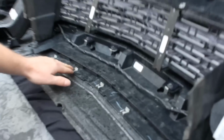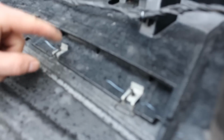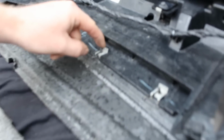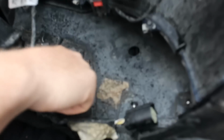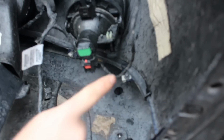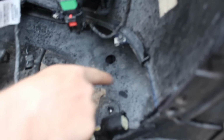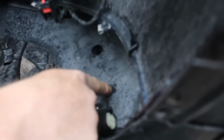You got these 5 mounting locations here that have these really small screws in here. So what we're going to do is remove these screws and remove these clips. Here in the corners, you're going to see another screw, another clip. This one's going to have to be removed. And we're going to drill a miscellaneous hole over here. The Defender Series comp splitters come pre-drilled, so there's no guesswork. So we're going to drill that and the other side in a moment.